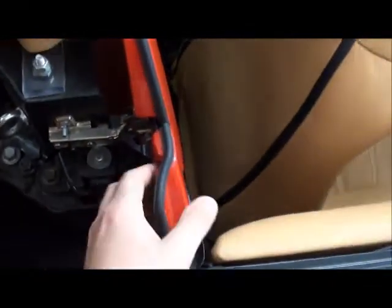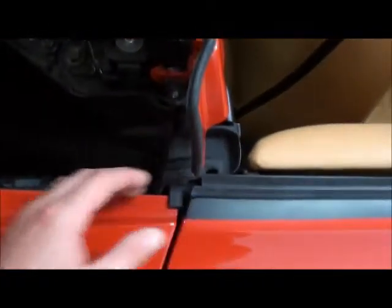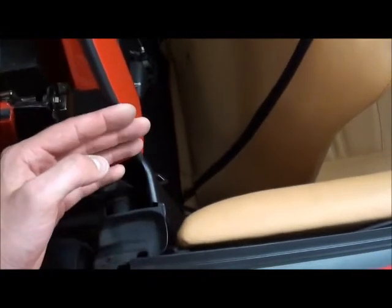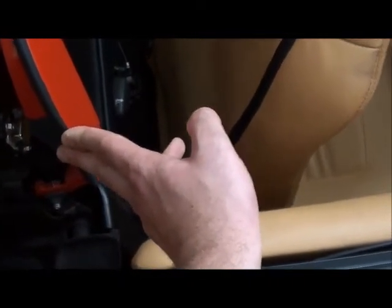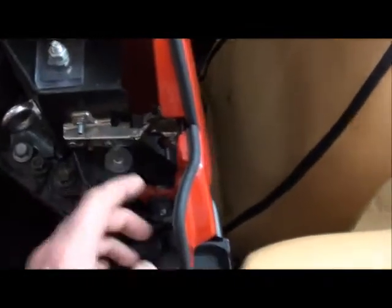The Z-flap — you'll have this roll bar cover and it'll be filled in all the way to there. The whole Z-flap thing is basically this: you get a butt hinge and this flap is literally hinged here. The problem is when the roof is up, this part comes all the way around and takes up all that space. If it's hinged there, the flap has nowhere to go but forward — it'll stick, you could bang your shoulder on it getting in and out, it can break off, and it looks bad bending forward.